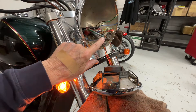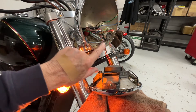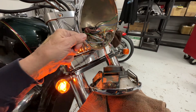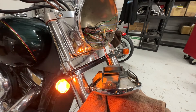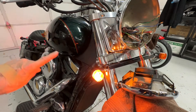Black with yellow stripe to black with yellow stripe. Then green to green — it's kind of a green-gray. And then blue to kind of blue and red. Plug those in and push them in all the way — make sure they go all the way in and make good contact. Then turn the key on, and voila — there's the flasher. You'll notice that the back is flashing as well as the front.